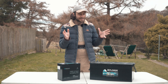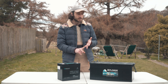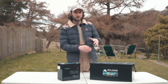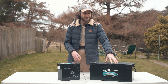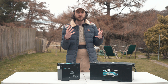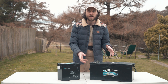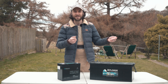So as we've seen there, there is a significant difference in weight between the two batteries, and that's a really important thing in camper builds. You've got a few different things to think about — one of them is payload. Installing a really heavy battery like this is going to add an extra 40 kilos compared to the Mini Core, which will really eat into your payload allowance. It's also going to affect your fuel efficiency, costing you more per mile, and it's really difficult to manhandle during installation.